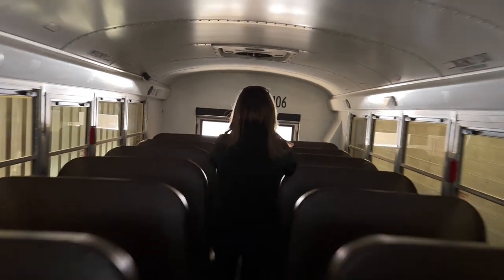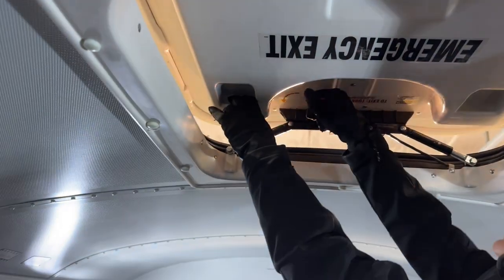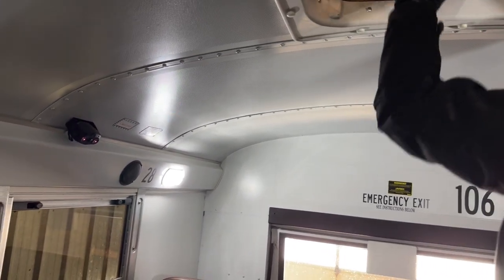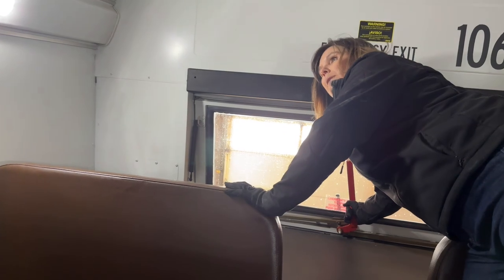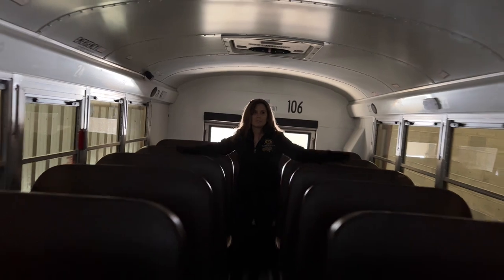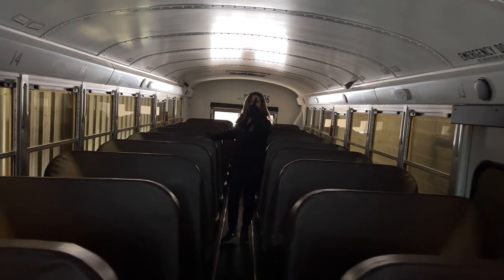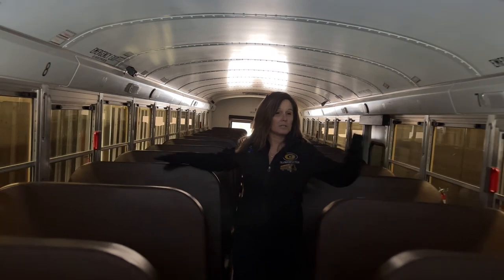We're going to check this emergency door hatch and my strobe light. The strobe light is clear, not cracked or broken, loose or missing, and it's functioning properly. Lights come on, buzzer sounds, opens freely, and it goes off when I close it. We'll also check the emergency window at the back — lights come on, buzzer sounds, it opens freely, and when I close it, it all goes off. We'll check our seat backs — not cracked or broken, loose or missing. We would check them all the same way, all the way up. I would check my roof hatch up front the same way I checked in back, and all of my windows would be checked the same way.